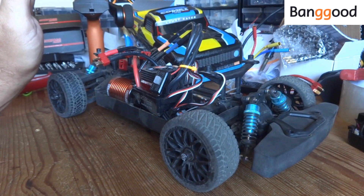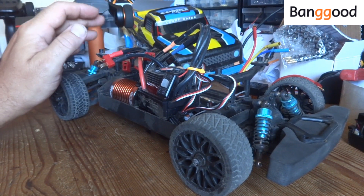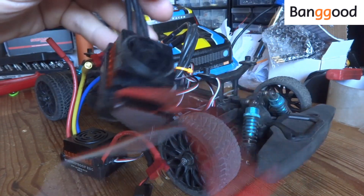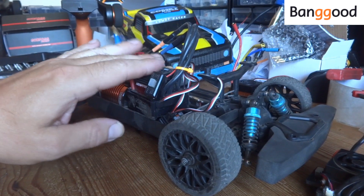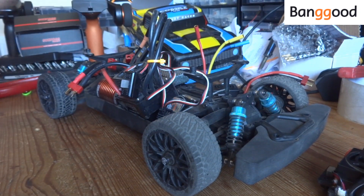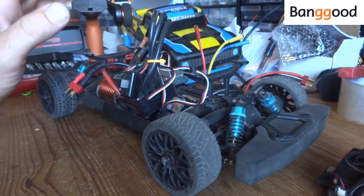Back inside. Now what have we learnt? Well, we've learnt that it doesn't matter how many amps you put through a motor — if it's reached its revolutions-per-volt limit, you're not going to get any more top speed out of it by applying more amps. It's purely just down to applying more voltage. You might get a bit more urgency and grunt out of it, but as far as top speed goes, it's going to remain pretty much the same. I've also learnt that this thing is absolutely bonkers on 4S — it's virtually uncontrollable. You can literally give it a third to a half throttle, and at any more than that the thing just spins out. I tried and tried over and over to get top speed. There was no chance. I got 34.2 miles an hour out of it, but as soon as you give it above a third to half throttle, the thing just spins out. It's absolutely bonkers.